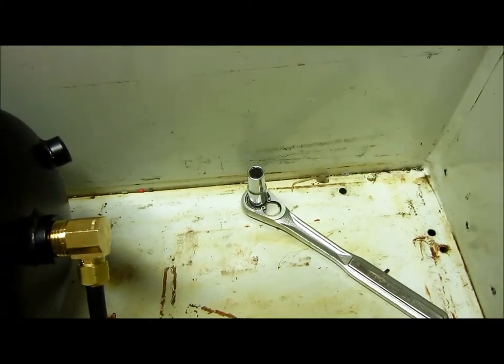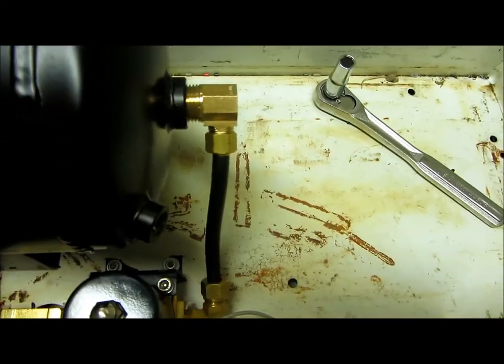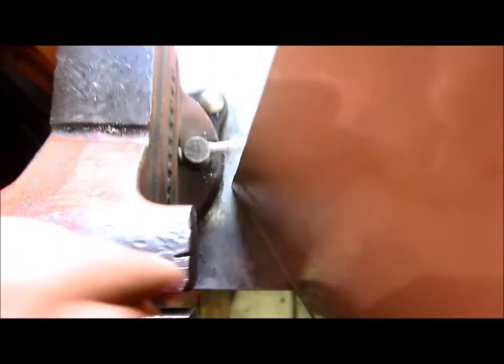We're gonna tinker on this and see if maybe I can use up some of these holes I already have drilled in here. If not, that's okay. It's a little wonky so I'm gonna have to plate the bottom — at least plate the bolt holes. Hey look at that — when I moved it I shoved it right through there, nothing but net. That won't happen again, might put a dent in it next time. Where my trailer plug goes in and out, I need to put a plate on the back side where it bolts, because when I pull the trailer plug in and out this thing moves quite a bit. So I'm gonna cut out a little plate to put there that'll bolt through and then it shouldn't go anywhere.